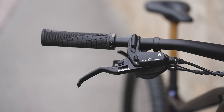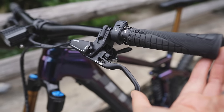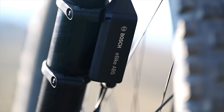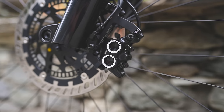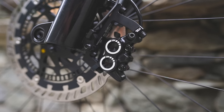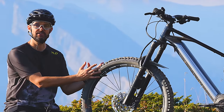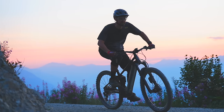There are Magura hydraulic brakes with a bespoke lever made for the system, and the ABS control unit, which is the heart of the e-bike system. To put it simply, when the system detects the front wheel is locking up, the ABS control unit reduces braking force in a fraction of a second. Importantly, the ABS system is only on the front wheel — it's only active on the front, which is really where you want it.